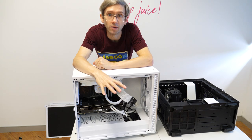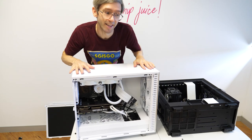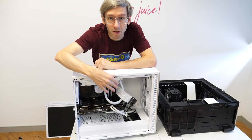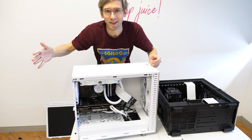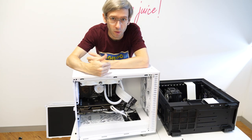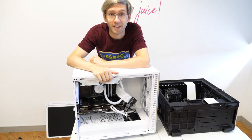I do have a spare slot for another capture device, which is one of the pros of having this EATX motherboard. Unfortunately the case didn't really fit it so I do have some problems with cable management — the cables are feeding out through the bottom as opposed to where they're supposed to go because the EATX board encroaches on those routing slots. The next size up cases are massive and I didn't want an absolutely massive case. EATX will give you more PCI and more features, however you've got to find a case that properly fits it if you want clean cable management.